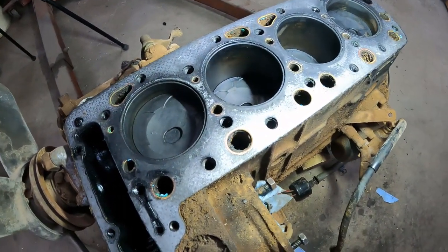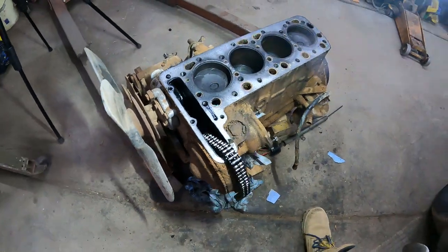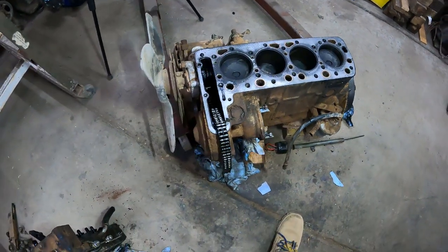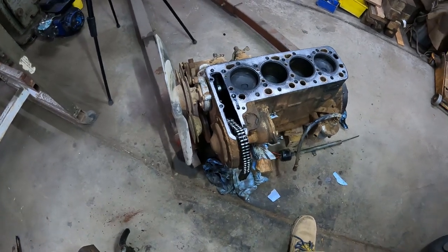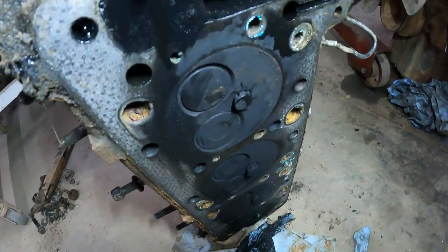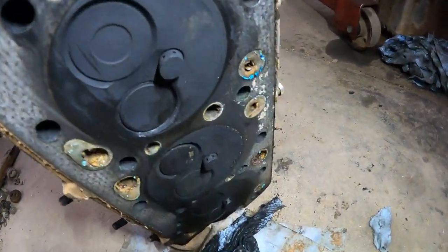I had no compression, or 15 bar with oil. I had to give them oil to even get there, which is nothing. Sometimes I will start with 18, maybe 19, but at 15 I couldn't get it to run. So I don't know what's going on. It had a newer head gasket on it. It looks like one pre-chamber is not installed deep enough.